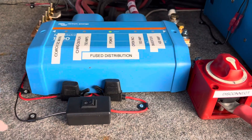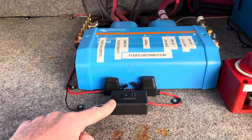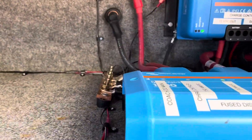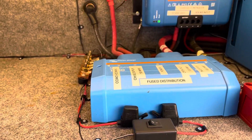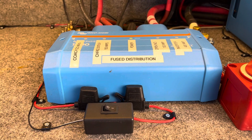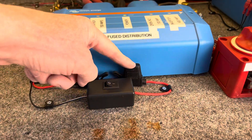I decided to put a light in here, so with two more fuses I put not only a light inside this compartment but also wired up a cooling fan. For the light I bought some 3M adhesive LED light strips — the wiring for that is the small stuff that goes up the roof — and you can see the strips of LED lights here, they go both directions. Turning on this switch right here will turn on all the lights, so I have visibility to replace any branch circuit fuses in this box. If the main T-fuse goes out then there's no lights at all and you're using a flashlight. That's wired with a one-amp fuse and a two-amp fuse for the cooling system.